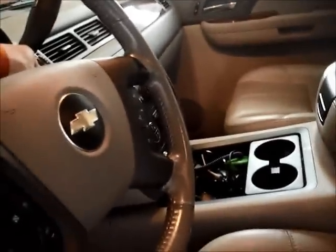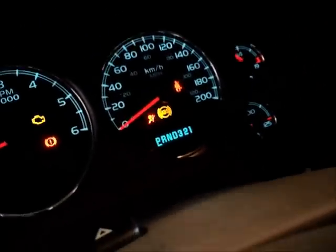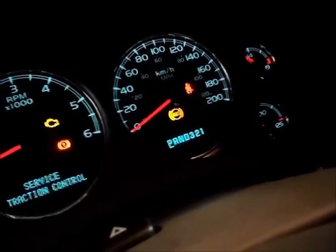I'm going to go ahead and put the battery back on and hook the power back to the vehicle. Back in the vehicle, I'm going to turn the key on — stay clear of the airbag system and the steering wheel, you never know. Vehicle's on, the airbag light is blinking. Let's see if it goes out — and it did.